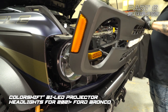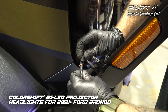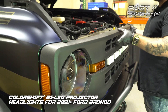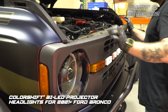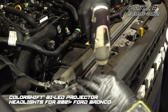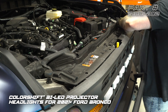Now we're going to bring our grille over and set that here so we can plug in our side markers. Grab that side marker cable we left to the side earlier. We're going to make sure that we line up the two arrows so the keyways are matched, tighten down our screw to make these waterproof, and tuck that in. We're going to line our grille back up, make sure all of the clips are pushed in, and put our four 10-millimeters back in. Then we're going to put our core support panel back on, get that intake locked into place, put our push clips back in, and we're good to go.